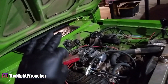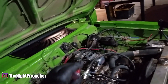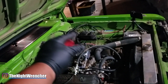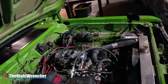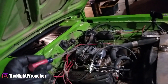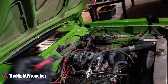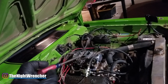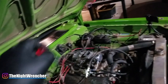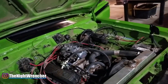That took about 15 minutes including all the cuts. Another note: if you're running a very heavy, lopey cam, it needs more fuel. First, you'll want a four corner idle carburetor because a two corner won't get enough air and fuel. Open up the secondaries a little bit to get good idle speed, and synchronize the back and front together to get the right transition on both sides. After you open up the rear, adjust it the exact same way. That about does it - I'll see you guys in the next one, Night Wrencher out.